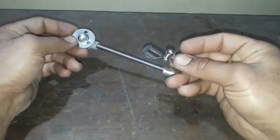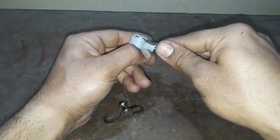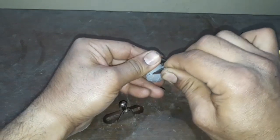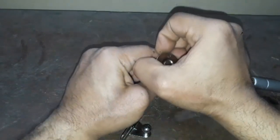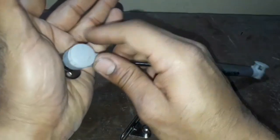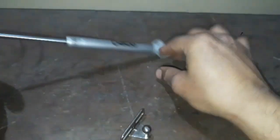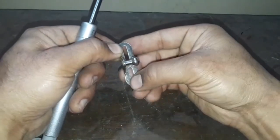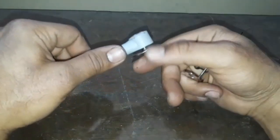You will get one or two units. With this we have two mounts and screws. To install the mount, we press it on the bar like this. We install the lock, plug it in, and then press the lock so it locks perfectly. This mount uses 2 screws — you have 4 positions, just put 1, 2, or 3. You get 3 screws with the kit. Let's go to the Activa and install it.